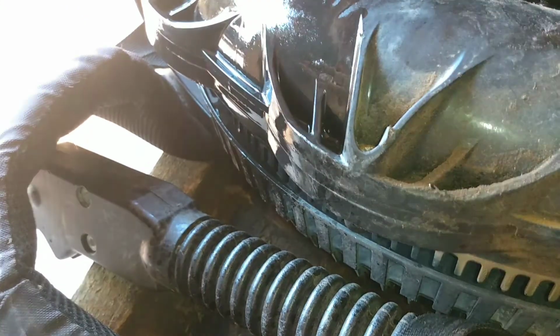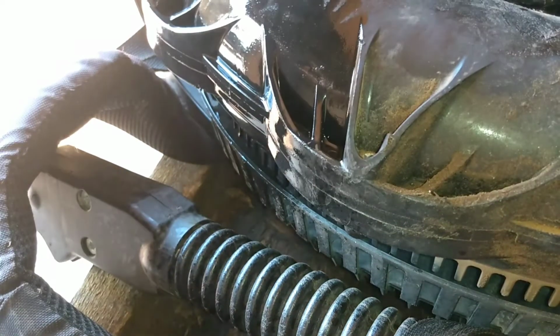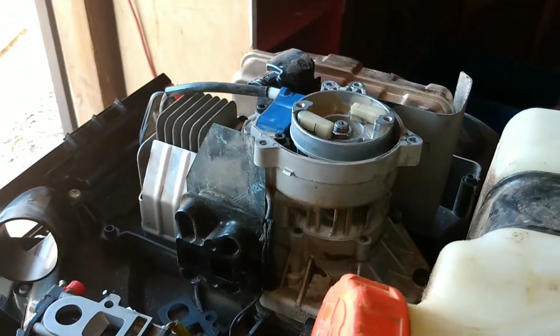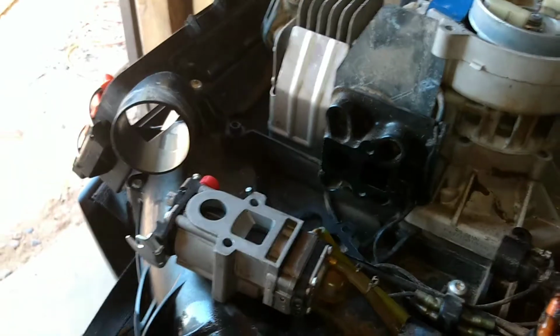Like I said, I checked the timing. I know the timing is correct. I know that it's going to get fuel delivery now. I'll try to start it. And if that doesn't do it, I'm going to pull the exhaust off to make sure that it's breathing and that I've got good compression. So we've got those three things. This thing should be a runner and should go home. So, all right. Thanks for watching.